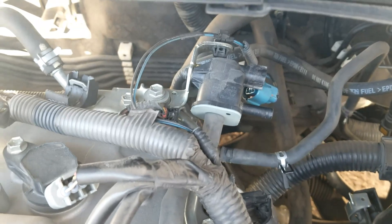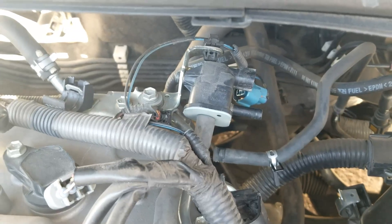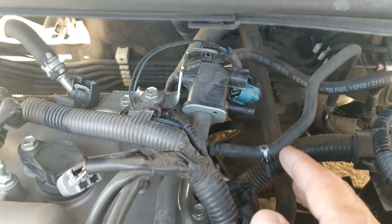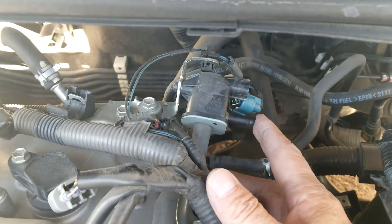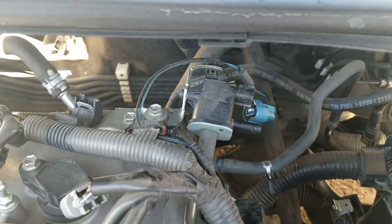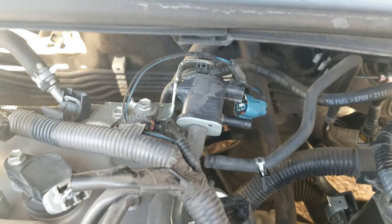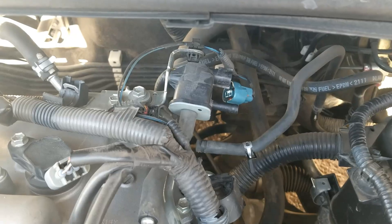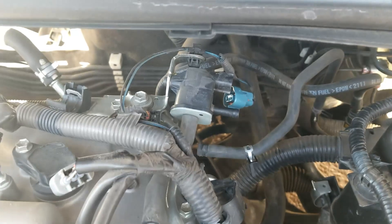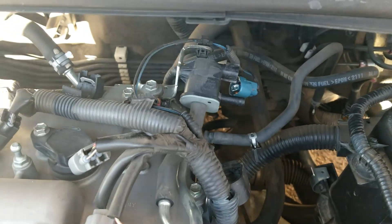Now this test is not going to check to see if it's stuck closed — this is only going to check to see if it's stuck open. I made another video on that and I'll put a link down below if you need to check that out. This is basically just to check if that purge valve is stuck open. Since the harness is disconnected and the computer can't send a signal to open it, it should be closed, and this should work on most any vehicle. If you have anything to add, please comment down below. If you have any questions, ask me. If this video helps you, please click like, subscribe, and have a good day.